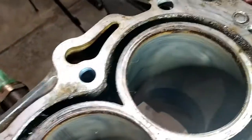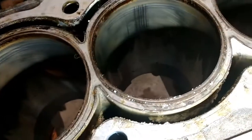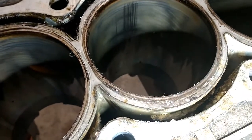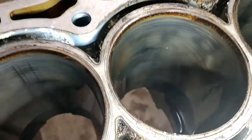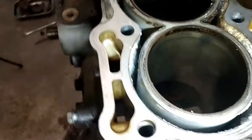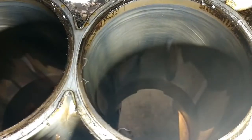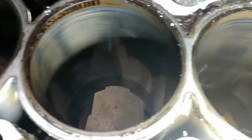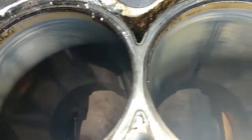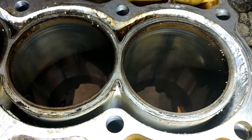Looking back down on the top of the block again, in the cylinder walls — just a quick look. That one there has got some places, but I'm going to see if I can catch it with my fingernail. I'm not too concerned. I don't see any light reflecting off the sides; I don't think it's going to be an issue. Just about what you'd expect to see — this is an old, tired engine. It's probably got about 200,000 miles on it, maybe more, depending on what the guy told me when he sold the car. He had also put head gasket sealer in it, as I mentioned in the first video. We're going to hone that out and get those walls ready to reseat the new piston rings.